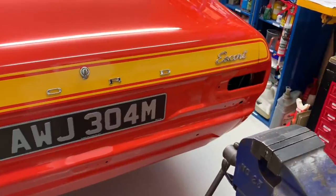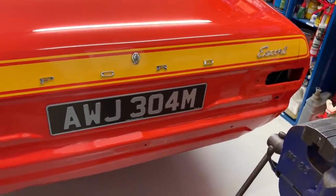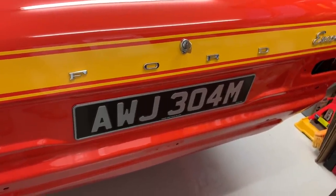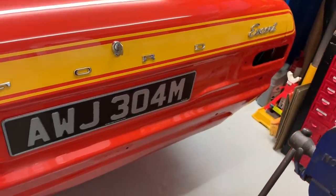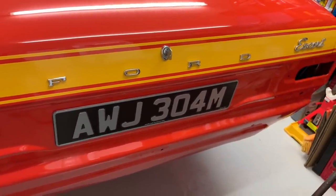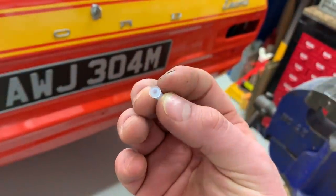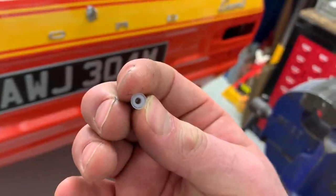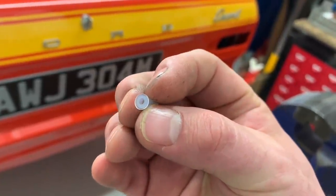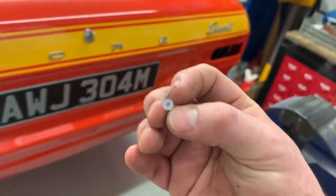That's the badges my mum got me for Christmas — fitted to the boot and the bonnet. They weren't the easiest thing to fit. I think the issue is the pins are just a little bit oversized after the chroming process. The original badges had a little metal insert, but now you fit them with little plastic ones. What I had to do was run a drill bit in and out of the clip just to open it out to accept the pins. Once you do it, they fit relatively well.